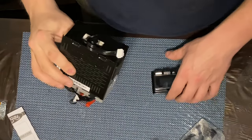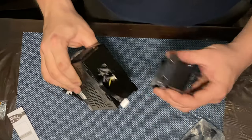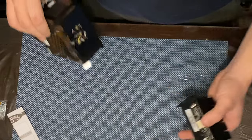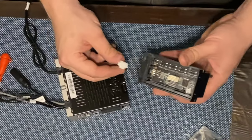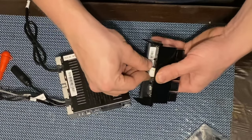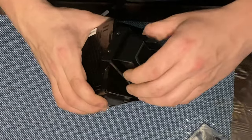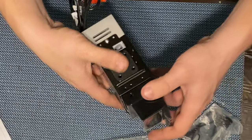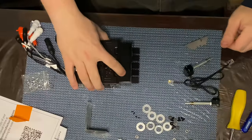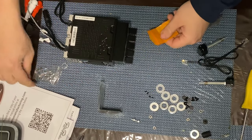While we're waiting for that faceplate to dry, we can go ahead and hook our faceplate up — the face that goes on here. All it does is it plugs in just like so, and then we put it over here. We've got some screws to get our hardware out and screw it together. It'll only plug in one way — this tab goes in line with that tab, so you can't put it in wrong. Tuck your wires back up in here like it was, and then it slides into these little grooves. It's got a metal bracket, slides in just like that, then pop our screws in. Finally found the screws for this faceplate — these four little screws were in an orange bag hidden inside another bag.